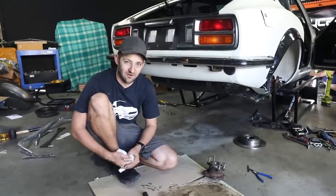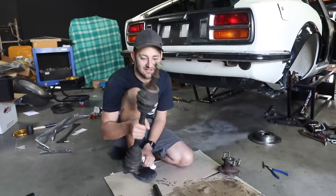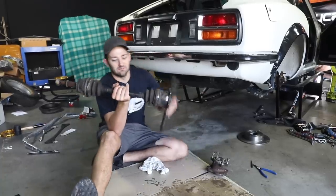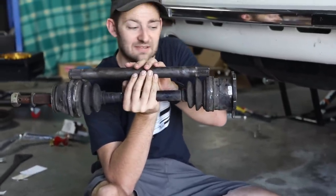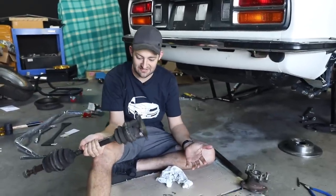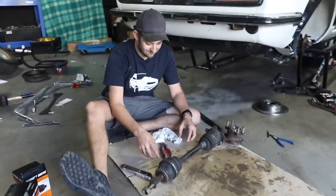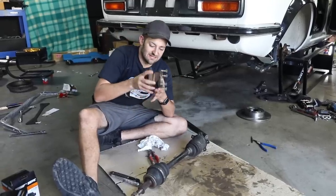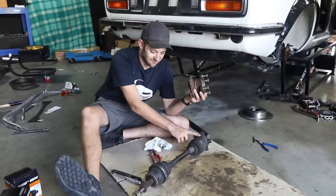I drew the short straw — today I am drive shaft guy. Benny thought it was going to be his job when he got here and was very relieved to find out I was already into it. As part of the kit, we have the whole axle — this is an R34 Skyline drive shaft, but we're going to replace that section because they're unequal lengths and also too long. This will shorten it and make them the same left and right. That involves pulling both CVs off — they're totally packed full of grease, they stink, they're messy, it's a really dirty job. So I've got to chop these off, remove the boots, knock them off, remove the circlips, take it all out, and then put the hub onto the hub carrier. This is all S13 Sylvia bits and R34 bits that happen to work because the splines are the same.